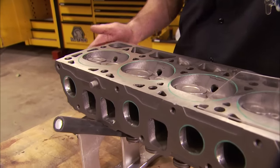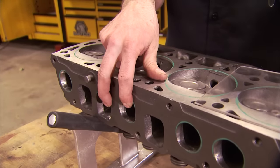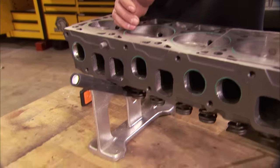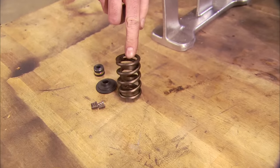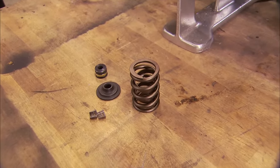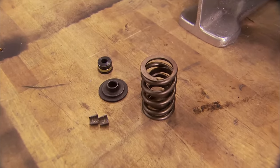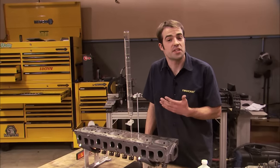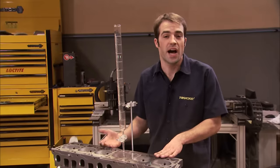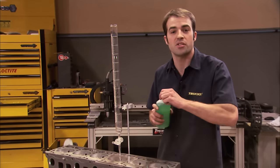This is the later model cylinder head that we showed you guys last time, that we picked up for less than 50 bucks. We sent it off to the machine shop where they cleaned it and resurfaced it. I've already gasket matched the intake and exhaust ports. For now, we've still got the stock valves and springs installed, but when we go back for final assembly, we're going to use these higher-rate Mopar performance springs, retainers, and locks that we picked up from Summit Racing. We've also got a new set of valve seals to install. Now using off-the-shelf pistons like we did saved us a few bucks, but it's also going to cause our compression ratio to be a little bit higher than we want. So we're going to buy some of that back by removing some material from the combustion chamber.